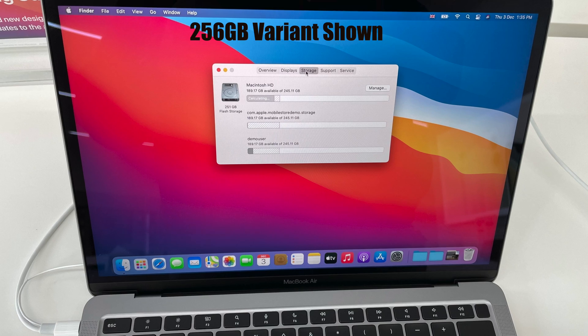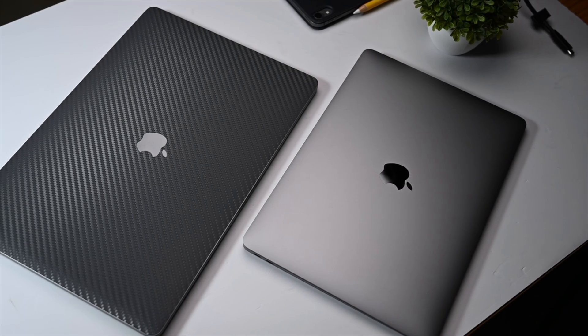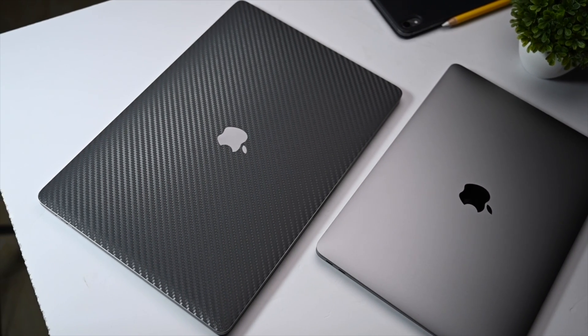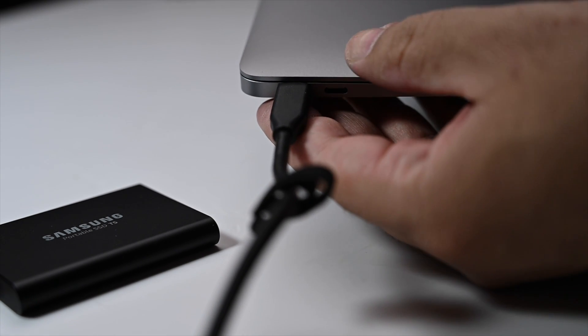I will dwell further on RAM in a future video, so do watch out for that. On the topic of storage, I would strongly suggest choosing the 512GB variant of the Air if you can afford it. I looked at the in-store display model and it was only showing around 189GB of storage free. If you do any kind of creative work, this will prove insufficient. Most people get around this by having an external SSD, and there's nothing wrong with that — that's how I edit my videos on my MacBook Pro 15-inch from 2018, which also has a 512GB SSD. But the thing that scares me is the vulnerability of the connection — it will take very little for the cable to bend and render the whole port and hence the logic board of the MacBook useless.